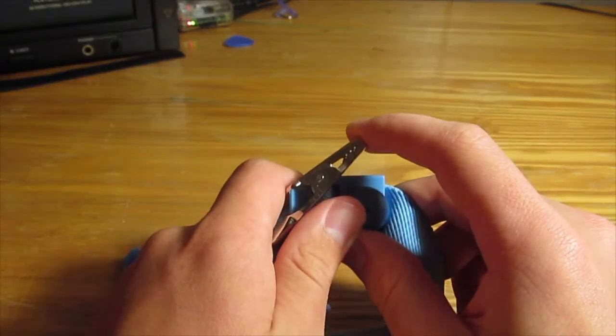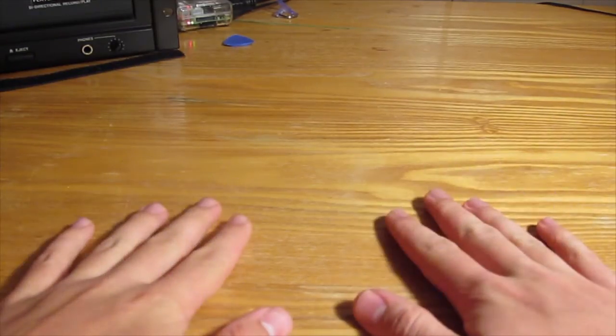You also want to have a good workstation, such as this one, made of a hard material. You do not want to do it on a bed or on a pillowcase, something like that. Just something that's non-conductive will not generate static.